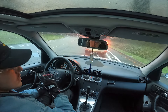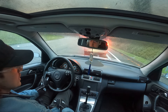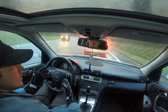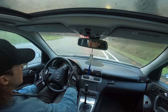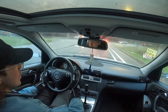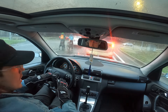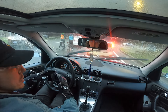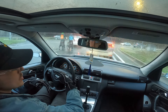One issue you guys will see - this is not from the tune, this was happening before the tune after I brought it back from sitting two months. It does this weird rev hang - kind of hit and miss when it does it. It'll rev to like 1200 RPM and just kind of sit there when I'm coming down to an idle or slowing down. Once I slow down all the way and get on the brakes and stop, then it will go back down to 600 RPM like it normally should. But it's definitely not what it's supposed to be doing.